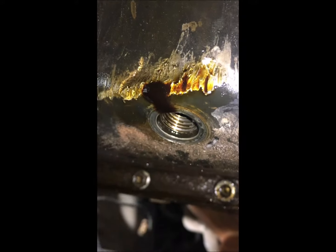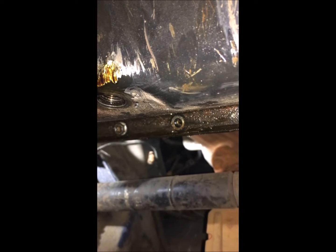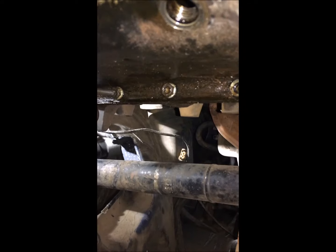In the service video I showed you how to loosen that — it's a 19-millimeter spanner bolt that you loosen and let your oil run out. As you can see my oil is still dripping a little bit, but I'm loosening my sump right now because I want to take the whole sump off to do the sump gasket. Around the sump there is a T40 spline that you use to loosen. I've already loosened most of the bolts, and I'm just going to loosen these last two here.